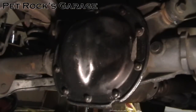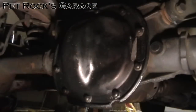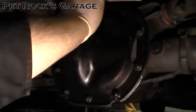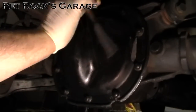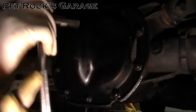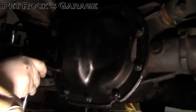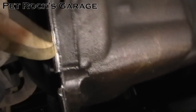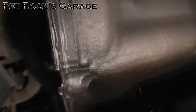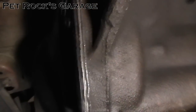Last but not least, take your identification tag and put it in the bolt hole. Throw all of these down finger tight in a star pattern just until they hit the differential cover — you do not want to tighten them down yet. Now take your wrench and tighten down each bolt until you start seeing RTV squish out. You don't want to tighten the bolts all the way — a little bead coming out the edges is perfect.